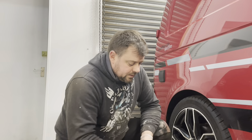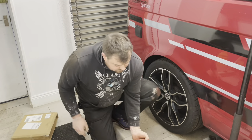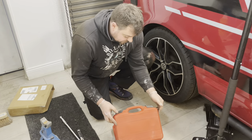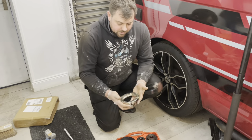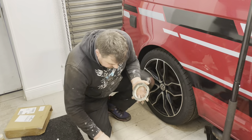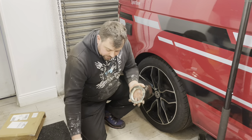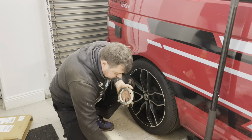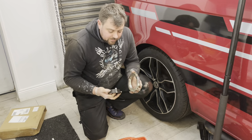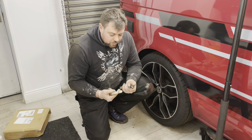I've always seen bolted-in bearings but these do the fronts as well on a Transporter - it's the same bearings all the way around. You also need a special tool to fit them which we had to order in. The special tool is basically a set of plates - a set of plates that screw together, a plate that the pins go in for pressing against the hub, attachments for going on the back of the bearing for pulling it back in. Yeah, this is what you need to do the bearings on this - you can't do these bearings without it.